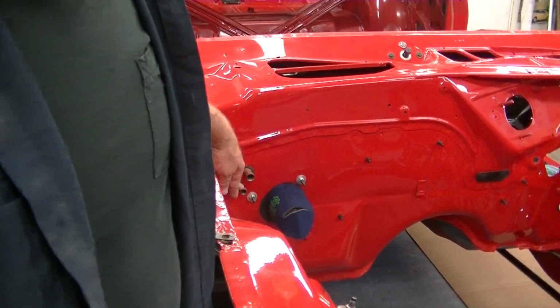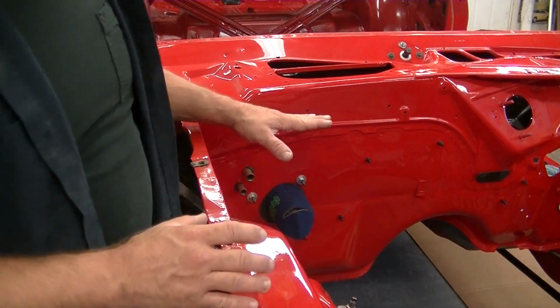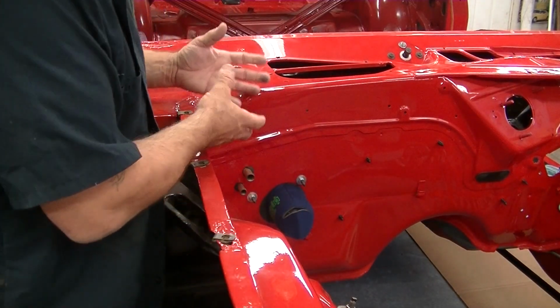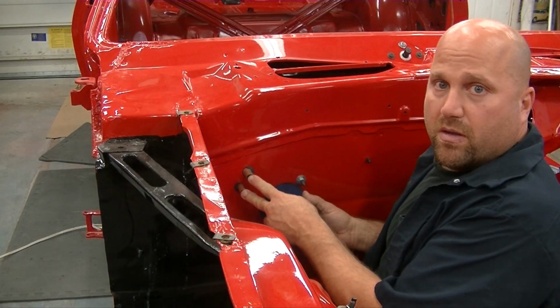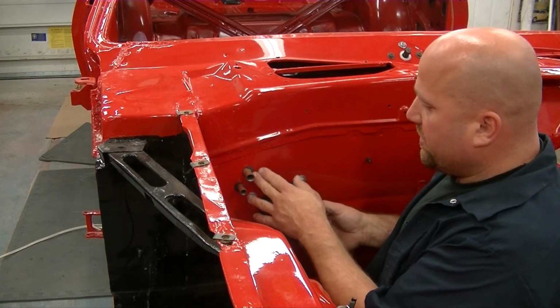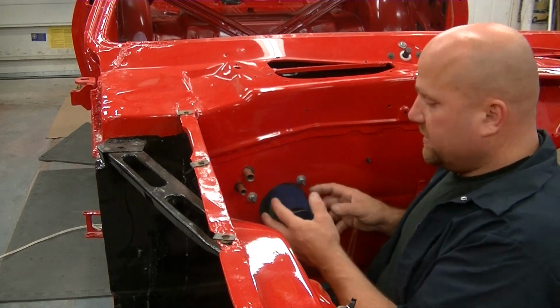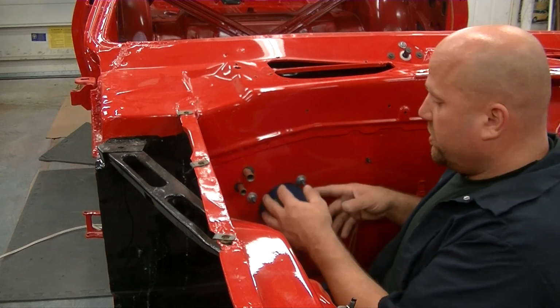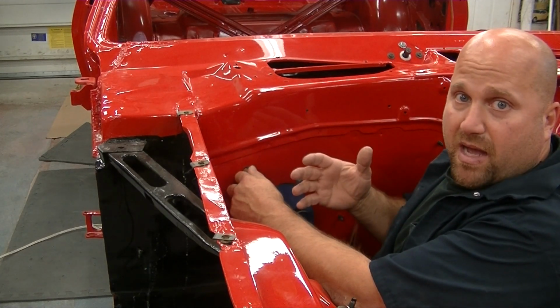That's where we come to the next step, which was installing this box. You need two guys, one on the inside, holding it and feeding it through, and making sure that the heater core water outlets are centered and coming through, along with the three studs that come out, and the motor that is pulled out and centered to the hole.